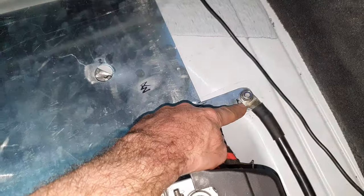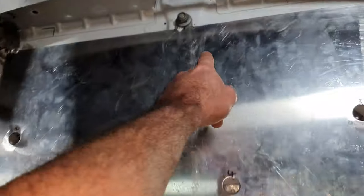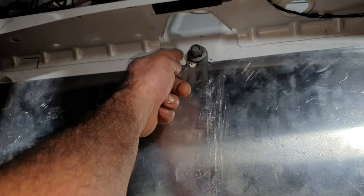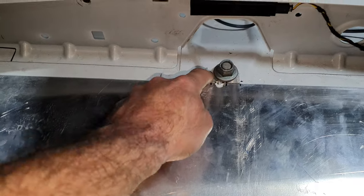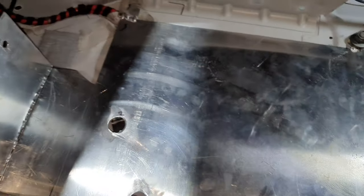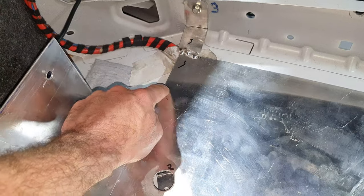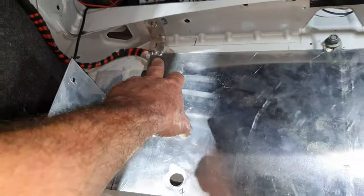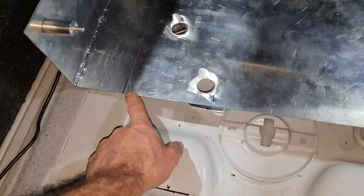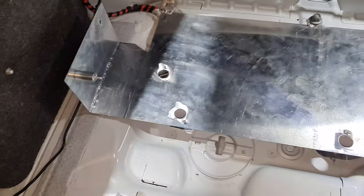Here is going to be the ground. At this point we're not going to have a rubber down. All the rest are going to have a rubber for the vibrations. And the same thing under this. This will be alright. This is 1 centimeter higher, and we need a clearance for the wiring under this. Here where it's passing the wire, we might make one cut so the wiring isn't squeezed, isn't under stress, and doesn't rub on the plate. The plate, like I said, is going to be dressed all the way around with a rubber at the end for protection.